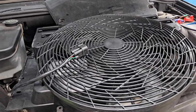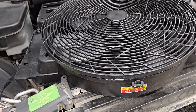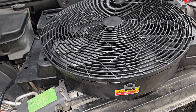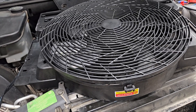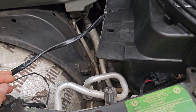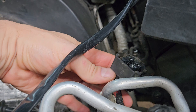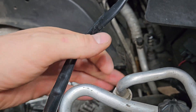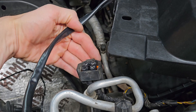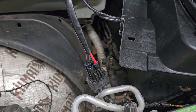This is a new fan, and I'm going to test it connected to see if it will activate with INPA. I didn't go too crazy on the testing because given the age of the car, I'm confident this fan is going to be the problem. Even if there was another issue, at this age changing the fan wouldn't be a bad idea either way. It's a three-pin connector.